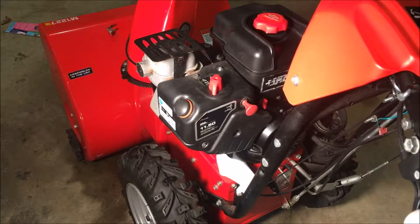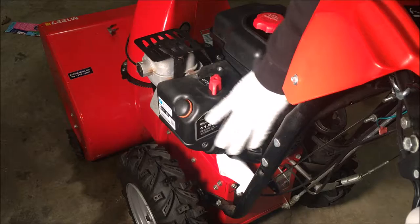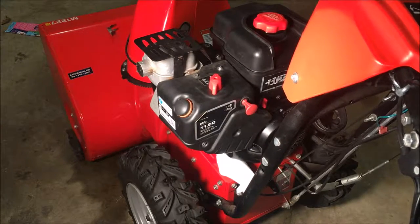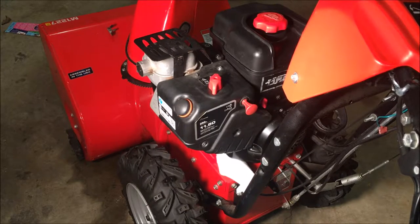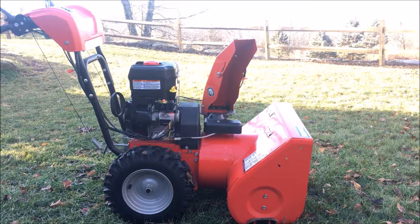All right, so that does it for now. Fuel tank's all set. New hoses, new valve. All this is back on. Choke is installed, no longer flooding. We should be good for contact. So it's a little bit late right now, so in the morning, I'm gonna bring this outside, turn it back on and see what we got. All right, let's see if this thing starts.